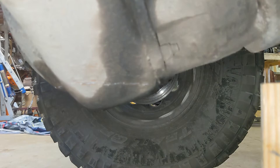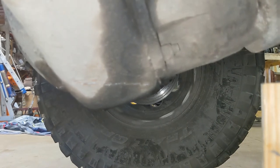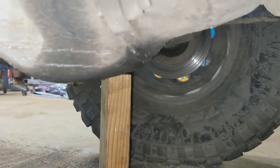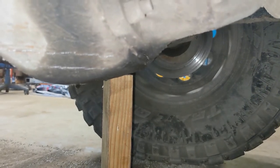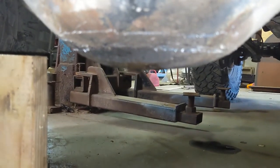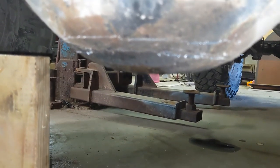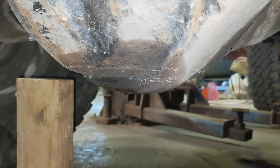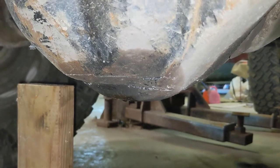I think I'm going to take about another half inch off my 2x4 and re-scribe this line. I think this looks a little more reasonable. We're going to miss the mounting flange there by a little bit, so I like that — about a half inch lower than we were. It's still going to give me about three quarters of an inch of shave on the bottom, which is pretty good. A nine inch is a smaller housing anyway, so that's still going to give me almost 13 inches of clearance under the diff, which is pretty darn good.